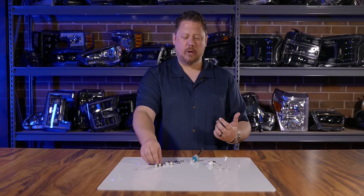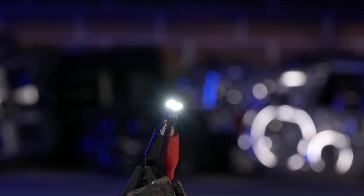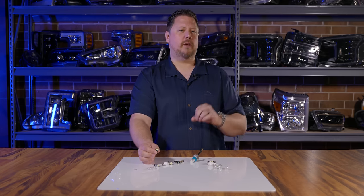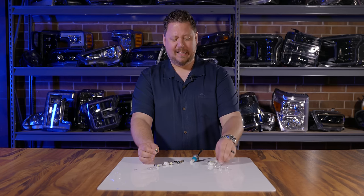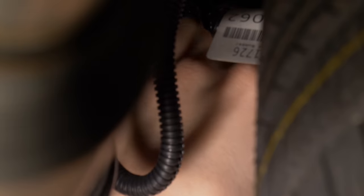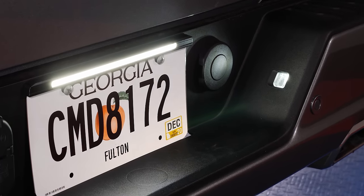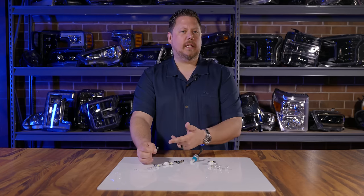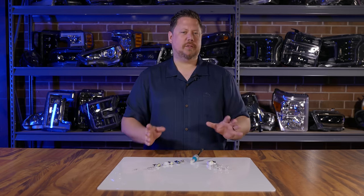If you have a directional light inside your vehicle, the Carbide T10 from GTR Lighting might not be a good bet because it's literally too bright — it could be uncomfortable in your car. Then I'd recommend something like the Low Pro T10 from GTR Lighting — all the LEDs shine one way but it's not nearly as bright. Also, if you have really low clearance where most LED bulbs don't fit, the GTR Lighting Low Pro T10 will fit perfectly. A really common place to need this is license plate lights, where there often isn't enough space. If you're concerned about fitment at all, this is a great option.